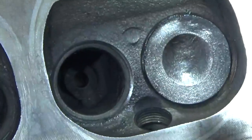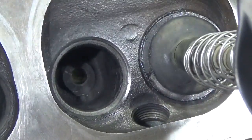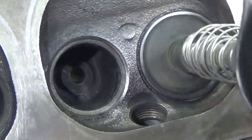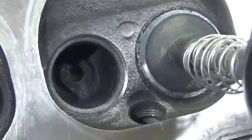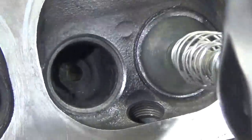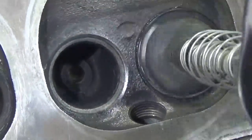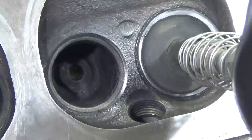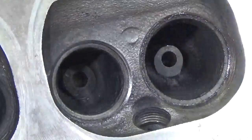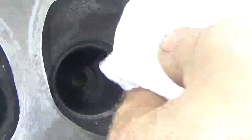I'm going to wipe this off a little bit. In a random fashion, you just put the suction cup on there and you turn the handle. You'll hear it be noisy and then it'll get quiet when it gets nice and smooth. You can hear how rough it is — keep going until it sounds nice and smooth. You can hear it getting quieter. So now I know that the face of the valve and the face of the seat will be nice and clean and I'll have a seal between the valve and the valve seat.